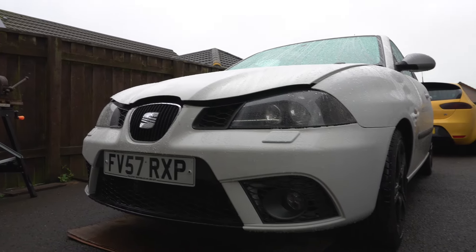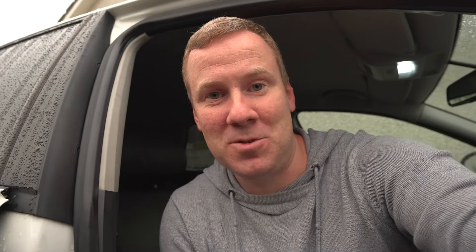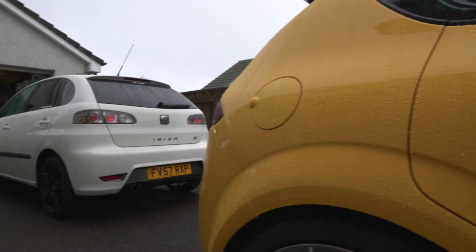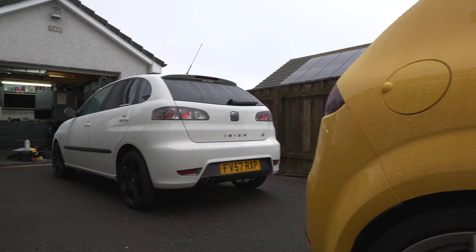That's exactly the issue I have with my trusty Seat Ibiza here — the project car I got back on the road and gave a clean bill of health for its MOT. But now I'm having this warm start issue where when I try to start the car after stopping for a few minutes following a long journey, it won't start quickly. It does finally start but takes ages to turn over. Hopefully I want to fix it in this video.